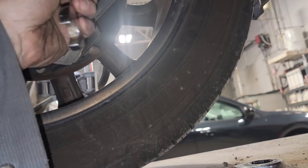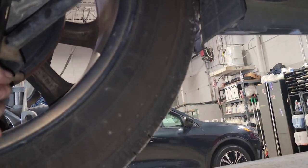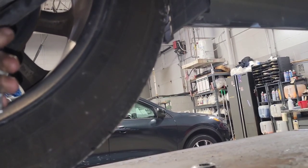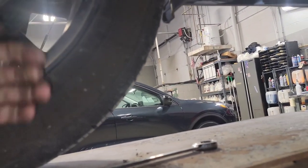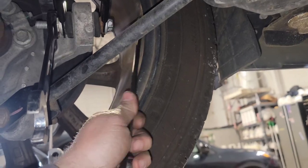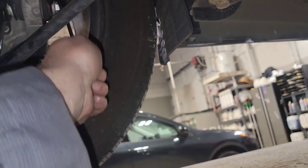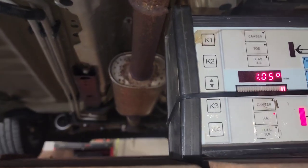You can see I've got an 18 and a 21 millimeter — that's what I'm using to loosen the bolt that holds the toe link to the actual knuckle itself. I'm trying to find a good spot where I can keep it so it doesn't fall off; it's hard to do it by yourself. I'm voicing over this instead of playing it live because my co-worker has loud music on in the background.